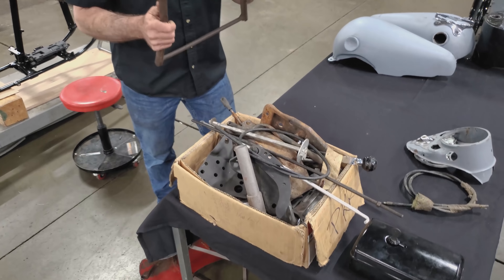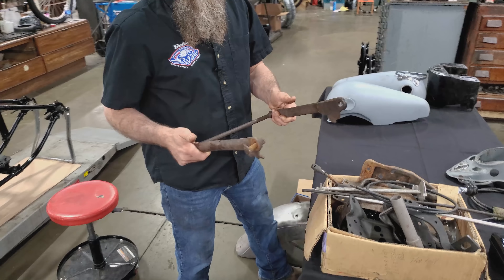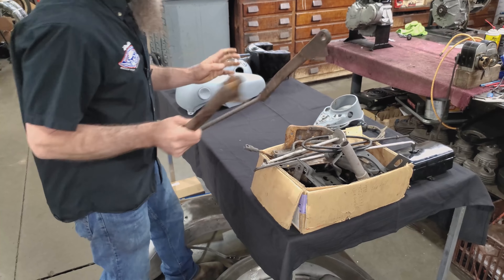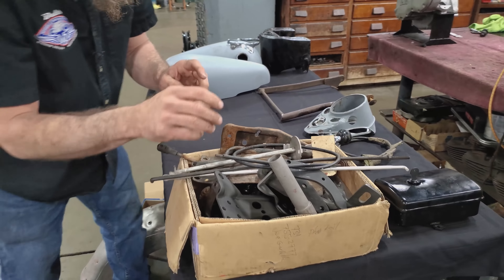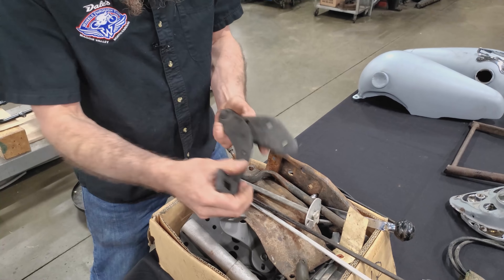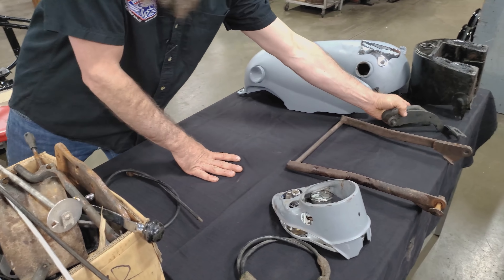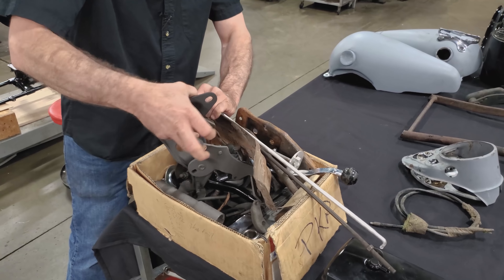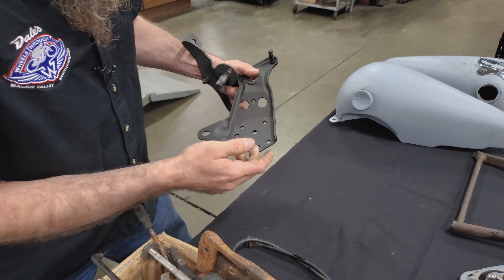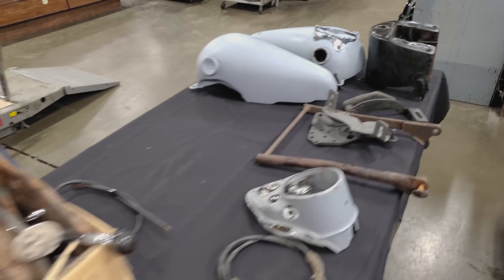The stand — these parts are incredible. Stand two years only, 1936 and '37. Just to find a stand like this — 20 years ago you might find one or two at a swap meet. Nowadays, unobtainium. So '37 only rear stand. Two-year-only brake pedal, two-hole early mount system, with the wide pad. Two-year-only brake, 1937. Two-year-only clutch pedal, same — this type of clutch pedal is what we call the two-hole backing plate. This one's already been restored. Really, really rare stuff, happy to be putting it on this bike.